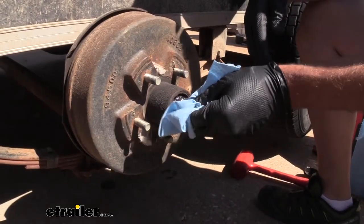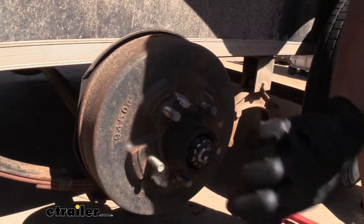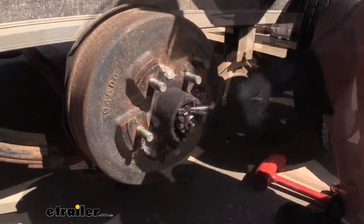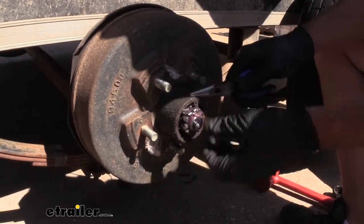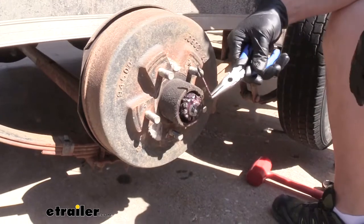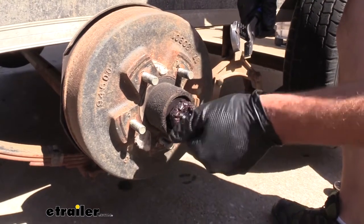You can see with that grease off, this one has a cotter pin right here. Some of them are going to have different styles — some will have a keeper that slides over. It doesn't really matter which one you've got; just hang on to it because we will be reusing it. So here with the cotter pin, we need to straighten that out and begin to push it downward so we can get a hold of it on its bottom side. Now we just want to back off this large nut — we're going to hang on to this and reuse it just like our keeper.